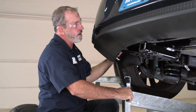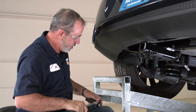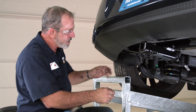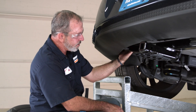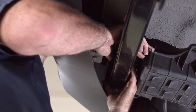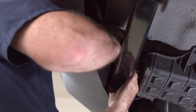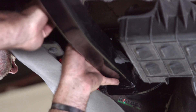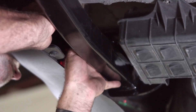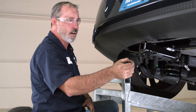That's the last one on the driver side. Before we put it all back together, I do want to talk about the lower attachment point on the bottom of the frame. The manufacturer designed this hitch so that it's nearly impossible to get a torque wrench on that bolt, so I just took a box wrench and tightened it to what I thought was going to be about 48 foot-pounds. With that said, let's go ahead and put everything back together — I'll start with the exhaust.